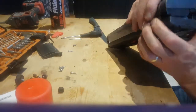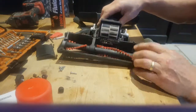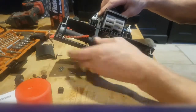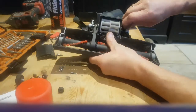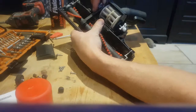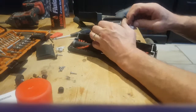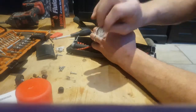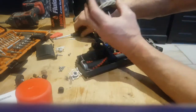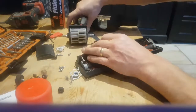So get to there, spin it around, grab the entire top off. Inside you've got your impeller, drive belt, brush, and these two guides. Set the brush out - just squeeze that in the middle and pull it up. Take that one off - there's a little washer inside there. Slide the belt off. There's your impeller - give that a clean, make sure it's tidy.